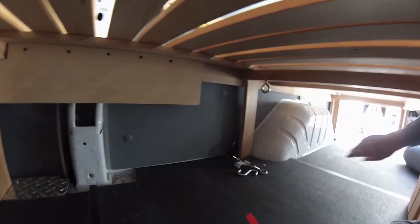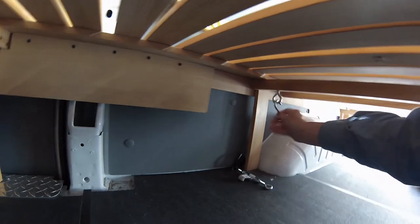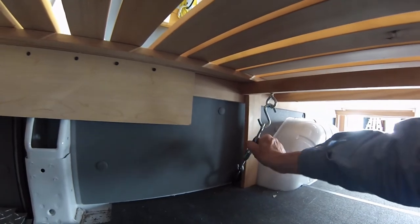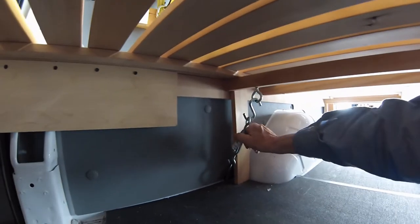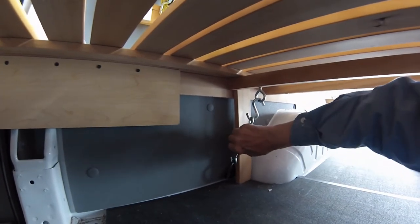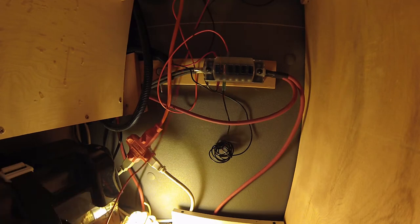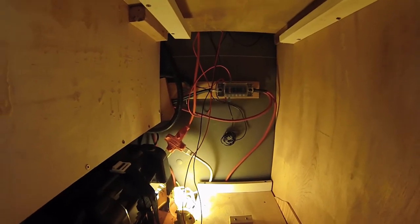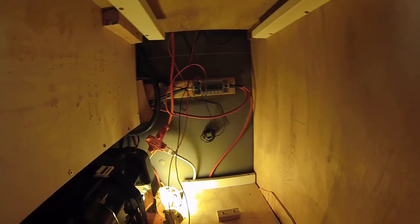This is part of the quick disconnect system we have here. I'll just ring, line this up. And there we have everything in place and secure. So, the next big thing is to bring these wires in from the fan and hook them up to the fuse box. So, get them all strung in. It's just a matter of crimping on lugs and putting in a fuse.